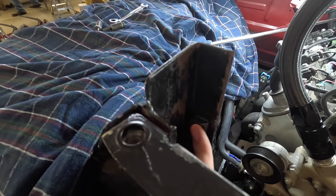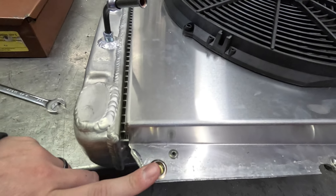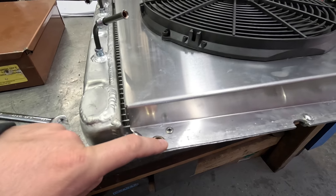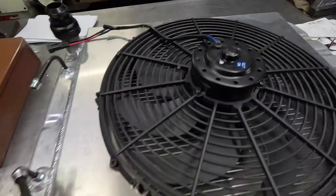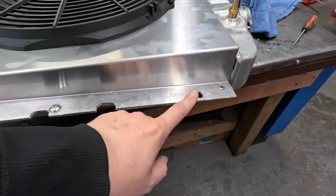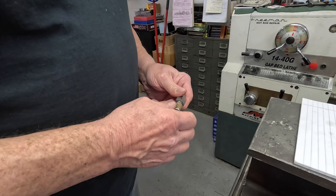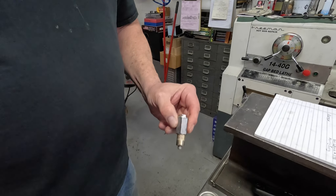To be fair, putting the radiator in and out was not an easy job — kind of a hassle. You had to use a magnet, put a washer in, run the bolt through the washer, push the bolt through, put the spacer down with a magnet, run it through. So what dad's doing now — he's already drilled these inserts out, so now they've been drilled out. He's putting threaded inserts into the actual fan shroud and the radiator itself.